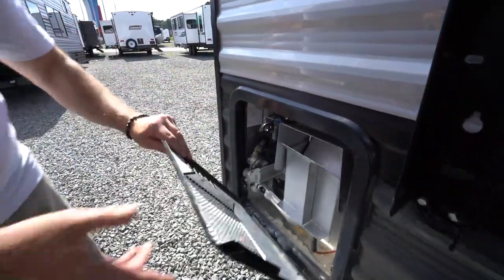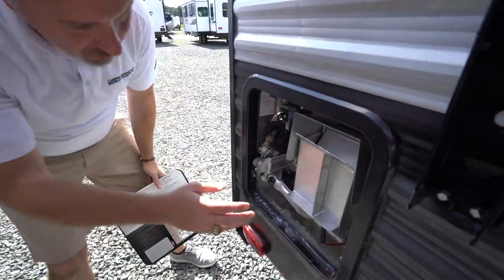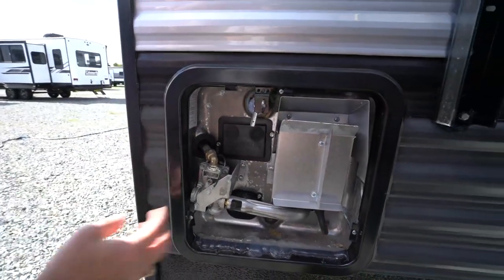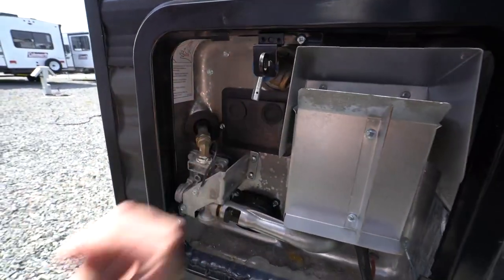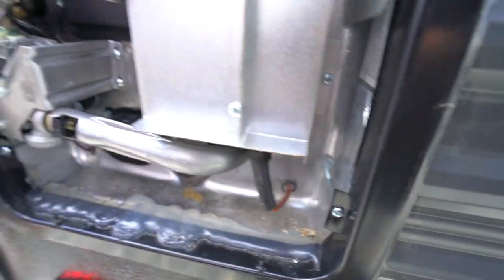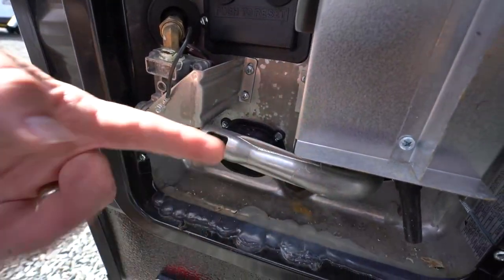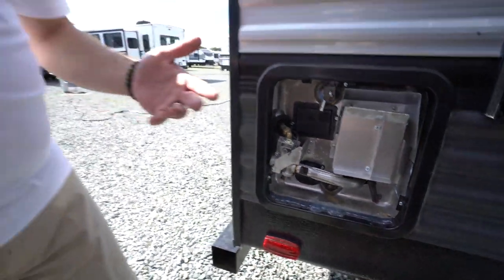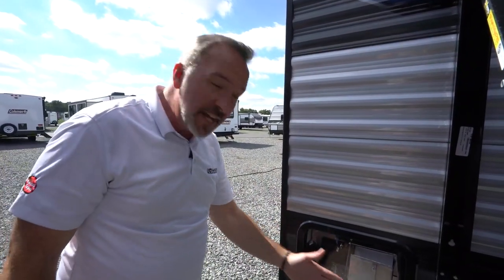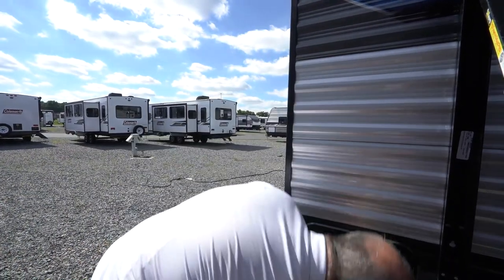Right here we have our hot water heater. A few things to note: if you're going to change the anode rod or relieve the pressure, right here behind the latch is the pressure release valve. If you need to reset it, you've got the double press button to reset right there. Right in here is your flame tube and your igniter is back under here. A good rule of thumb, especially if you're bringing it out of storage, get some pipe cleaners and clean this tube out, because propane has a chemical in it known as mercaptan that is very attractive to dirt daubers, bees, and spiders. A nest in there could cause a flame-up and also cause your hot water heater not to work.